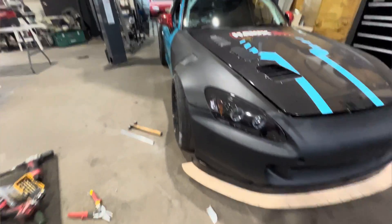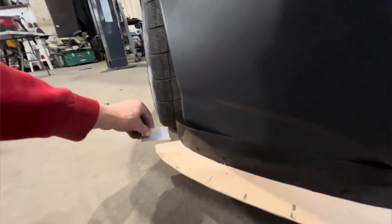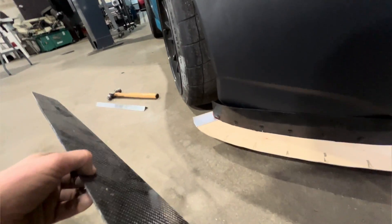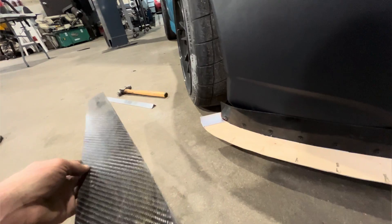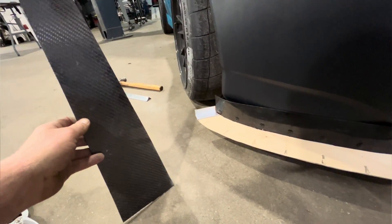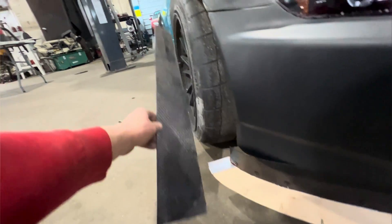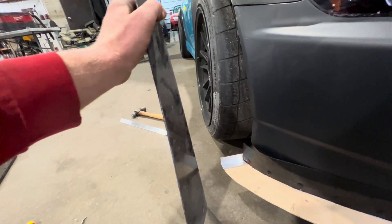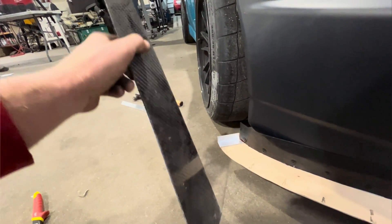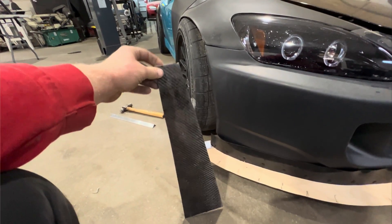The last bit is filling this area. This is typically what I do — a little L-bracket there, and then I use just this one-millimeter-thick carbon fiber sheet. You can get this stuff on Amazon in 24-by-24 sheets; it's actually not that expensive. I cut it out to about the rough shape, and the trick with this stuff is heating it up slowly — it becomes very pliable, you can bend it, and once it cools down it holds the shape really nicely. Let's get those mounted.